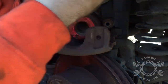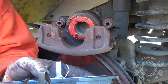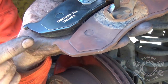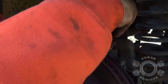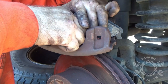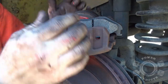Take your new pad — look at them carefully. Don't go face to face like this because they'd be going in backwards. Turn them so the springs are facing up. Look — you've got a little notch here and notch here. Check that right side so you know you've got them oriented correctly. I have made that mistake several times. Get in there and snap that thing in.